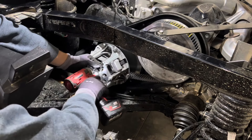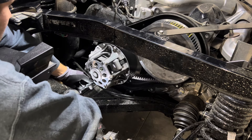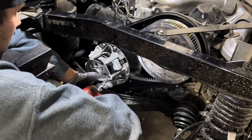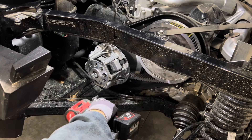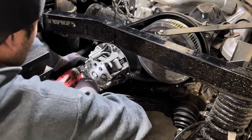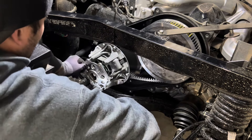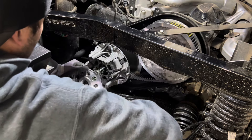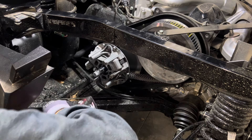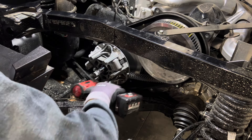So we're going to take our 12 millimeter and pull these clutch cover bolts. You have to pull them evenly — leave two that are right across from each other, put those aside, then walk the remaining ones out as evenly as possible. The factory spring is a little longer than ours so you'll have more tension. Our spring engages smoother so it won't have quite as much tension. Just be careful when pulling the cover off the first time that it doesn't pop off — you don't want to strip the ends of those bolts.